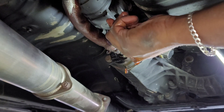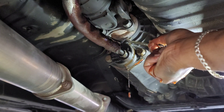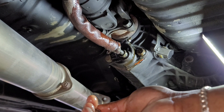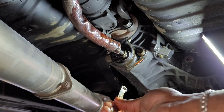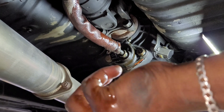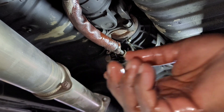Pressurize and that's straight fluid coming out - that's good. When I first did this, air shot out of there - nothing but air, no fluid. The second time, air and then a little bit of fluid. This time, all fluid shot out, so the system is bled. What you want to do now is connect your connector back up top.